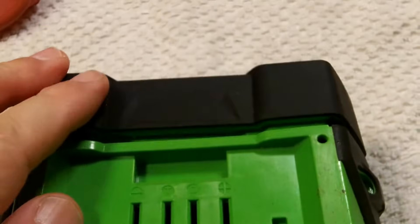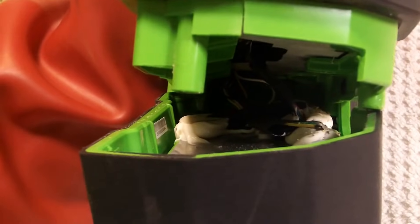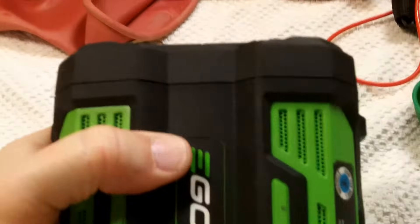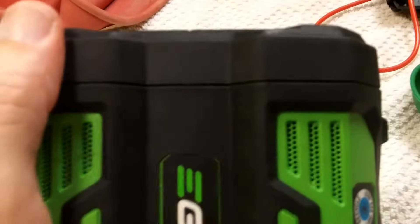This top section was stuck hard enough that I had to take my gloves off to get enough grip. I was able to push with two thumbs and pop it off, working my way around to get the top part loose. There's still a bunch of wires in there going between the BMS button assembly and the rest of the pack. None of them are hard current wires but some are 56-volt high-voltage sense leads. The bottom black end cap comes off the same way - I've been pushing up with both thumbs but may need a pry tool.